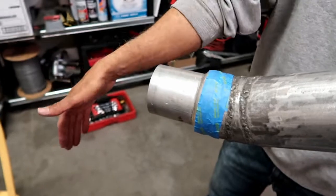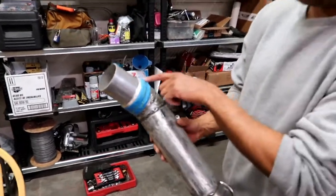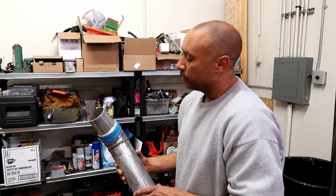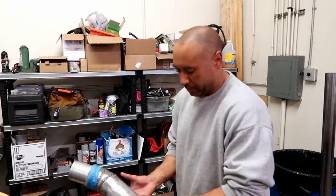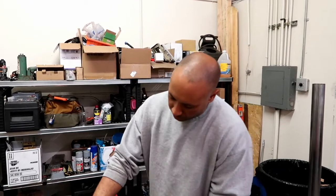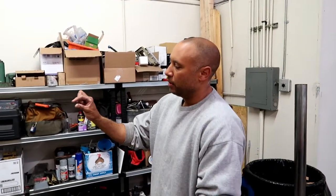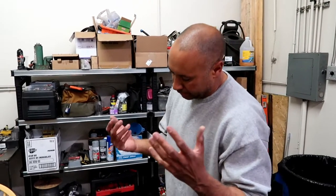We're going to run a three inch from here on out — it'll go down like a 90 over the frame rail and out the side under the truck. We cut the three and a half straight pipe off and got a three and a half to three inch reducer from NAPA. The reason: we're going to wrap the headers, and with the engine on rubber mounts that move under torque, the clearance with wrapping would have been touching. I also thought about raising the motor with a spacer under the mounts, but I didn't want to throw off the pinion angle and create a whole other set of problems. So this is how we're doing it.